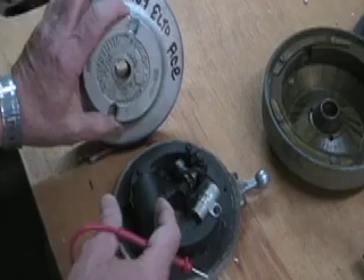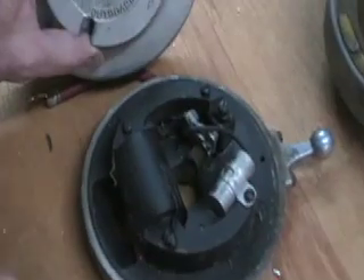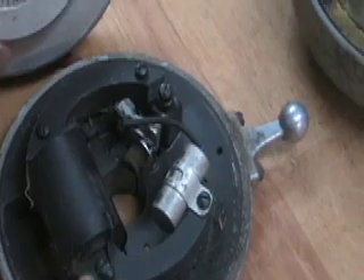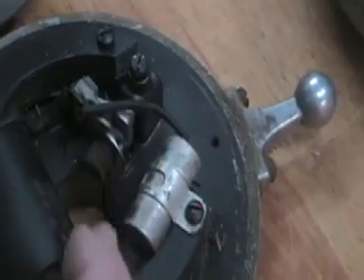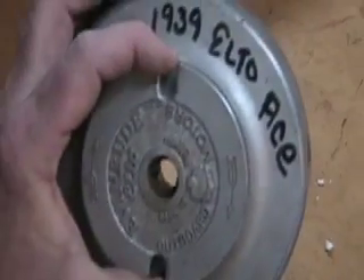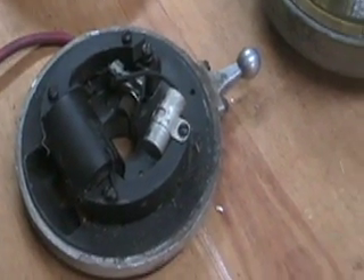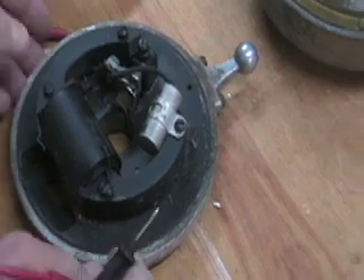This is a common type of single cylinder 1930s Evinrude Elto ignition magneto plate called a stator plate. It has the coil, the condenser, and a set of ignition points. Very often the ignition points are gummed up and need to be cleaned, but more often the coil is no good. That's the coil — this is from a 1939 Elto Ace, but this type of magneto is shared with their engines all through the 1930s.